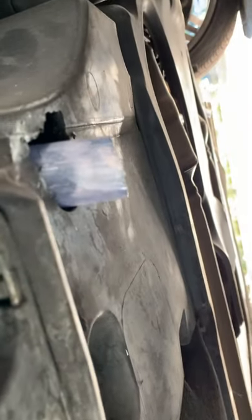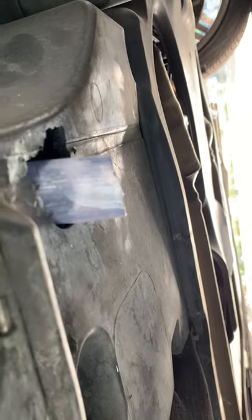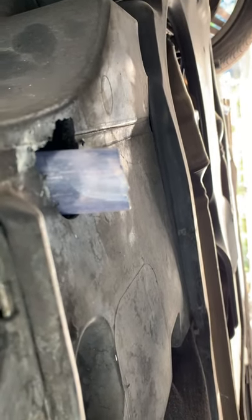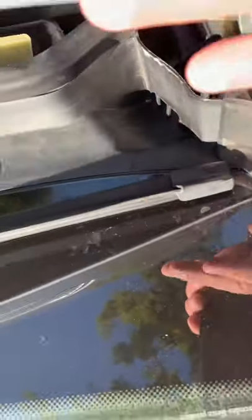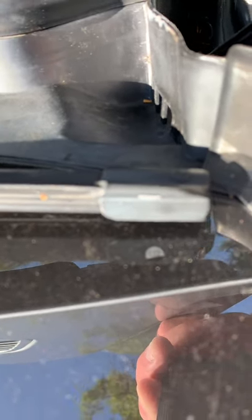What I've learned is if you blow an air compressor through the top of the cowl drain, not much is going to come out down here. What you actually have to do is put your air compressor blow gun up in the end of this tube and blow upward. The Cobalt blow gun has a beveled tip that basically seals the end of the tube, which pushes all the air forward and upward, blowing anything in that cowl drain out like Old Faithful. Stuff goes all over the windshield and hood, but you want to keep these drains clear — they're the Mercedes-Benz rain gutter.